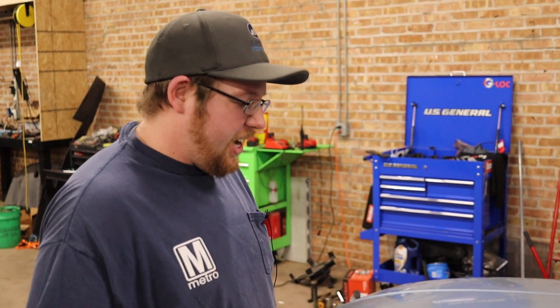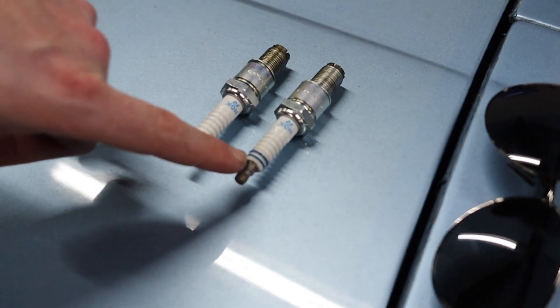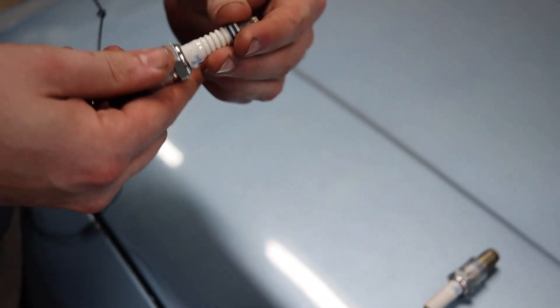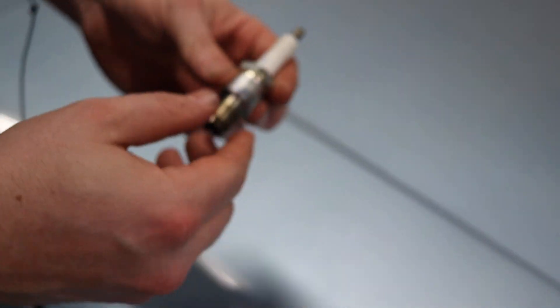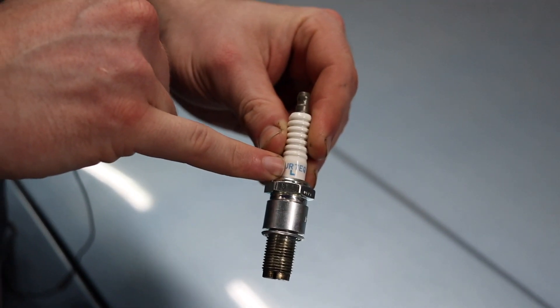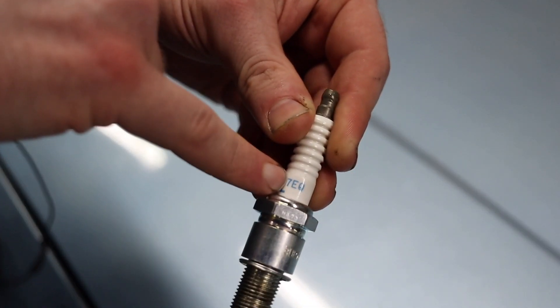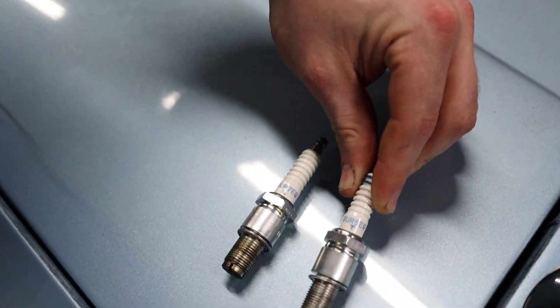Those are spark plugs. The end. The main differences between leading and trailing spark plugs — the way to identify them really fast is you see the two striped bands around the top of the porcelain. You can also tell because they'll have a letter: this is T for trailing, and then you'll also see L for leading. You'll also see the actual part number on the porcelain.